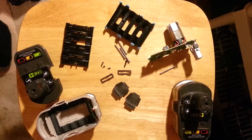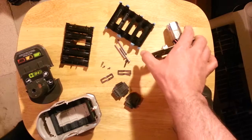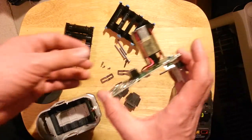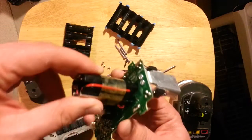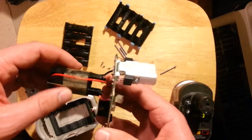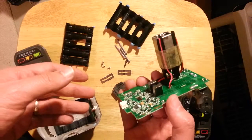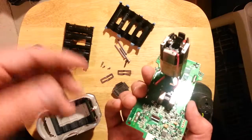After cutting through all of those and separating the board from the batteries, I then proceeded to continue tearing the battery pack the rest of the way down, and checked the voltages on all the batteries to see whether or not one — or more than one — was actually bad. In one of these battery packs, it turned out that only two of the ten batteries were bad, and that's still a suspected bad.